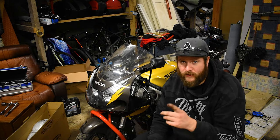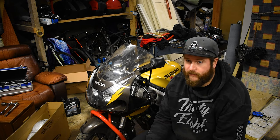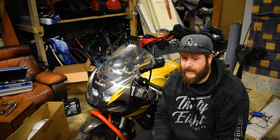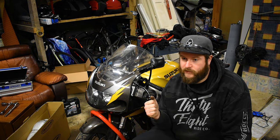And that's it. So if you watched, thank you very much for watching as always. I really hope you enjoyed this video. I hope you found it helpful. All I will say is, if you want to break apart brakes like that, you definitely need that piston tool. And if your rear brake is as bad as my rear brake was, you're going to need access to compressed air to get them out.